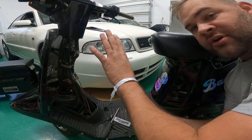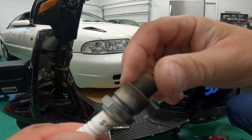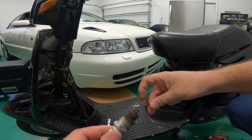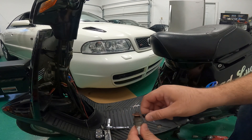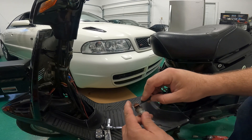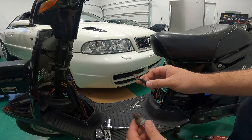My plan is to just run it in the same spot that I did for my marker lights, and I'll just run it through the cowl, and then up into the engine compartment. One thing you're going to want to do when you get the spark plug out is clip this sealing ring off here. You do not want this to stack on top of your temperature ring. So, you're going to cut this off, and your temperature ring will be what seals instead. And some of you might find that with your cylinder head, you might run out of room. It's possible you could have to bend this probe a little bit to get it to fit a different way — you might put it on and bend it upwards. Do whatever is necessary to get it out of the way of your spark plug wrench, but also fit within the cylinder head, keeping out of the way of the cooling fins.